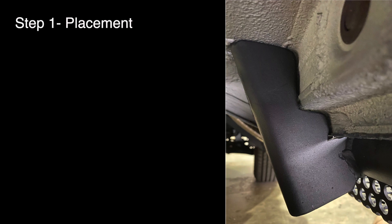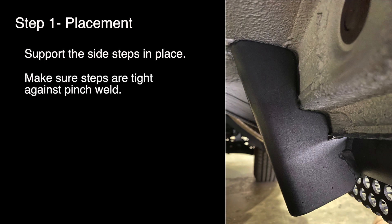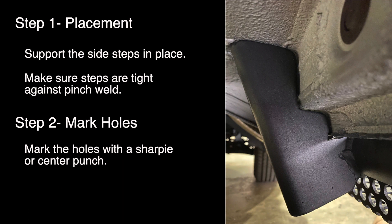The first thing you're going to want to do is put the steps in place, and this is where the jacks come in, the jack stand, or have somebody help you hold it in place. As long as the support brackets are tight up against the pinch weld and everything looks as it does in the picture, that is going to be the proper fit. Go outside and look at how the step is placed with respect to the entry step for the driver's door and the slider door. You want to move it back and forth so it has the most amount of step in front of those two doors. Once everything looks just perfect and the step is exactly where you want it, make sure it's securely in place and go ahead and mark the holes with a Sharpie or a center punch. With the undercoating being uneven and usually bumpy, it's a bit hard to do it with the Sharpie, so I do prefer a center punch to mark the hole.